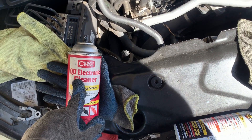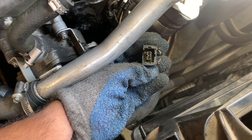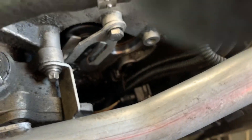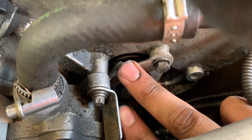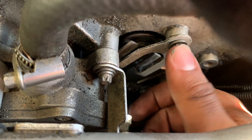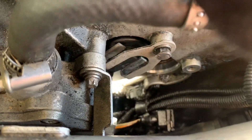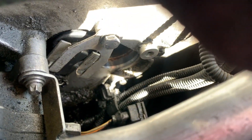It's also handy to have one of these around to clean the connection. As you can see on mine, it has oil and grease on it — it's always better to have it clean. When you get to the point of installing the bracket for the solenoid, make sure it's fully in. Push it in as hard as you can. The actual solenoid has to be flush, like before. When we put pressure into this, it's actually going to push in on the solenoid — obviously you don't want any oil leaking from here. Let's get this tied up and go on to the next solenoid.